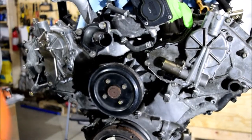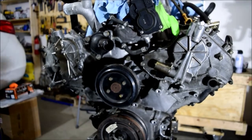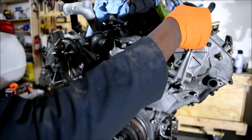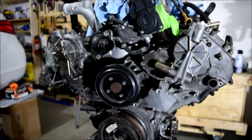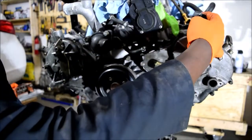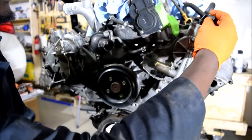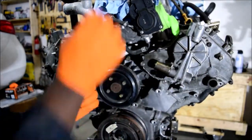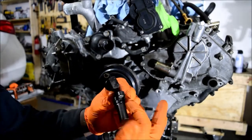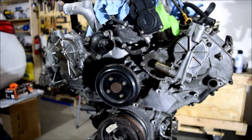Pulleys — that was one thing I wanted to do. By the way, since this side is pretty much done and ready, let me go ahead and install the sensors. Now these are both top corner sensors. Just a little bit of Vaseline. That's the VTC sensor, bank one.